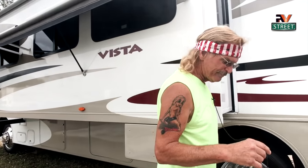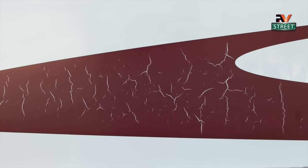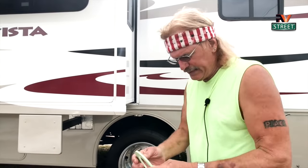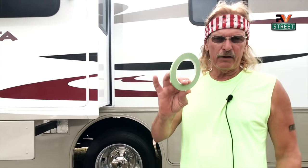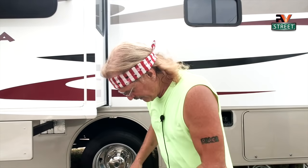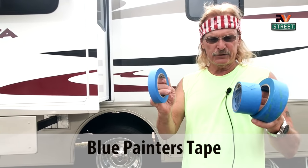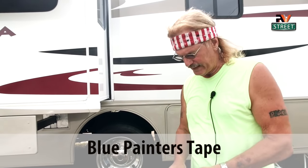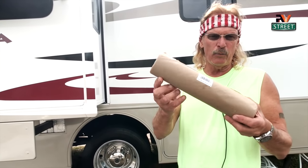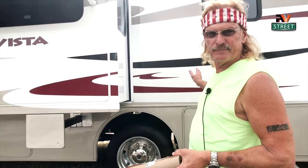For today we're going to deal with the third way — paint over the graphic. You'll need some quarter-inch or three-sixteenths auto detail tape. It comes off in small strips and it's easy to go around your old graphic and outline it. Then you follow up with masking tape — I have three sizes: one inch, inch and a half, and two inch — and continue to outline the border. Then cover the rest of the motorhome with paper to eliminate overspray. All these items were bought at Home Depot.